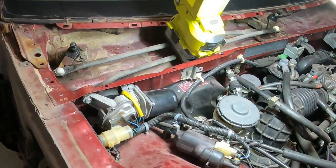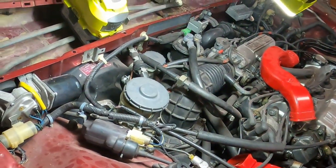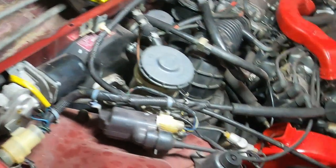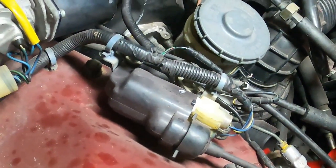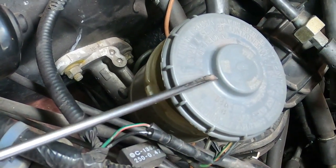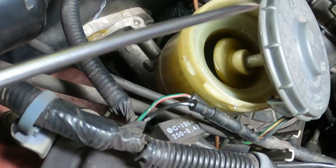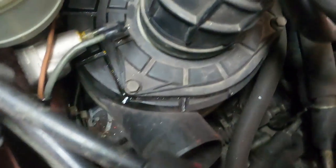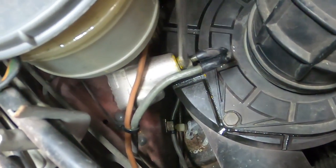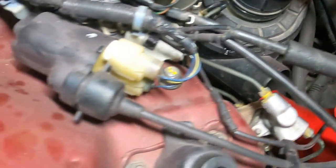Well boys and girls, I think we hit a snag. Nothing too serious — I mean if the engine is working, if the gear is working, everything is fine, anything else is a piece of cake. Tried to bleed the brake, didn't work. I thought at the beginning there's a lot of air inside. Sadly I was mistaken. A friend of mine — he's actually a mechanic — he came, had a look, tried to bleed it with me, and he said: you've got a master problem. So this is the master cylinder — this is basically where you top it up with the brake fluid. It's full, I'm trying to bleed it, so we decided to bleed from the brake lines over here. Nothing is coming up from one side. Fluid is coming out each time you try to pump the brake on one side, the other not so much. That can only mean that we've got a leak.